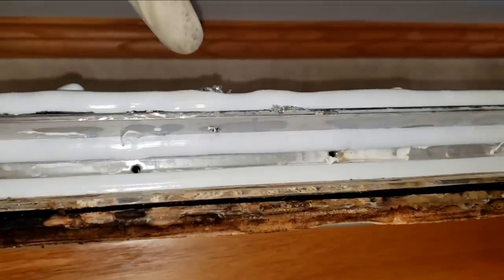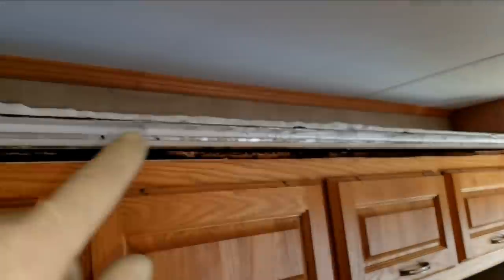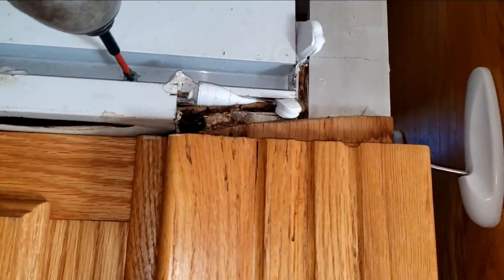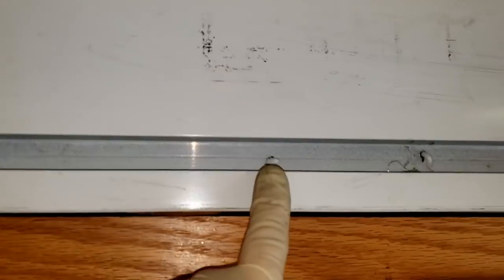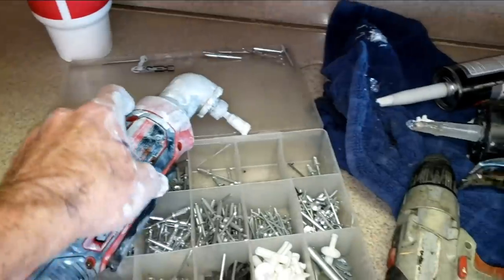These screws are actually running down into this fascia. I'll put one more bead on the back side of the fascia and then get this put back up. You'll see it oozing everywhere — it should be filling all the holes. I prefer a liquid sealant because it bridges gaps better than putty. All those screws holding the fascia are tight — you can see all the sealant oozing out because I put way too much, almost like I don't want this thing to leak again. These are where the wooden fascia still has to go on. I won't lie — I did not enjoy doing that.